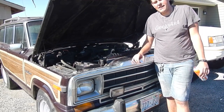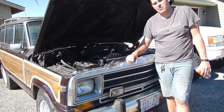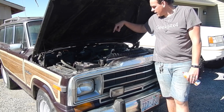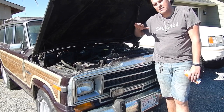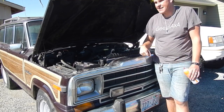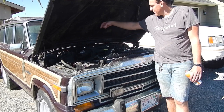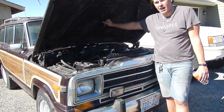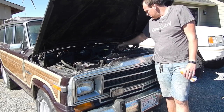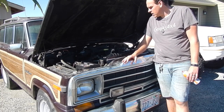So it's that idle down and die that I'm trying to fix. If you have any ideas on how to fix it, comment below. Let me know what you think it is. Like I said, it's got a new EGR valve. I believe I have the vacuum system minimalized down to zero, pretty much. The vacuum advance is directly to a vacuum port. The vacuum off of the EGR is directly to a vacuum port. And other than that, everything else is capped as far as vacuum goes.